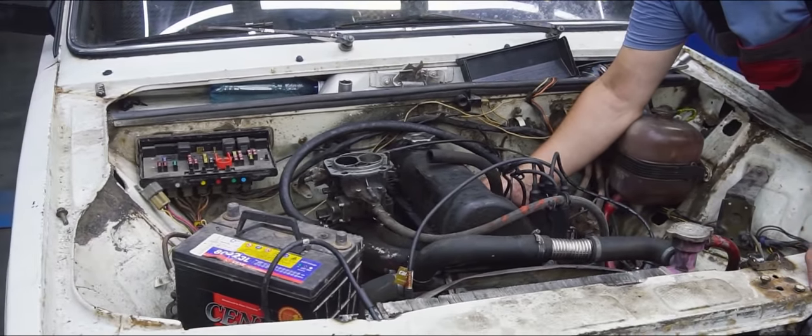This experiment has 107% been a success. No matter what sort of object makes it into the cylinders, it's life-threatening to the engine. You really need to be paying attention when you're replacing spark plugs — it'd be a good idea to blow some air into the wells before you pull them out, to remove any dust and other debris, keep it from getting into the combustion chamber, and ultimately ensure your engine a long and happy life. You saw it all for yourselves — what happens when something gets into the motor. It's as good as totaled. So keep an eye on these things. Watch us, subscribe, give us a big thumbs up. All right, catch you later.